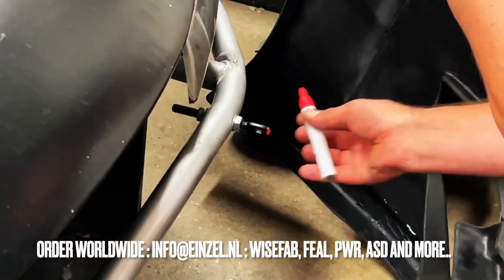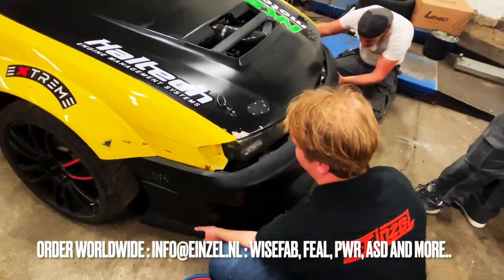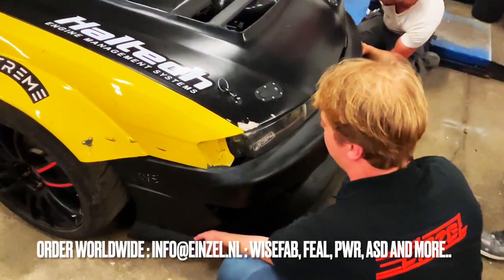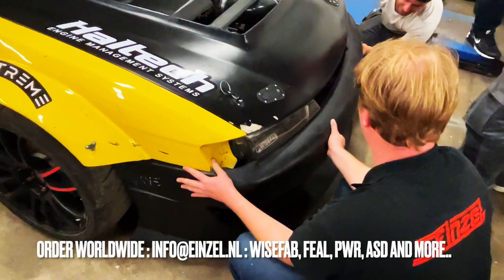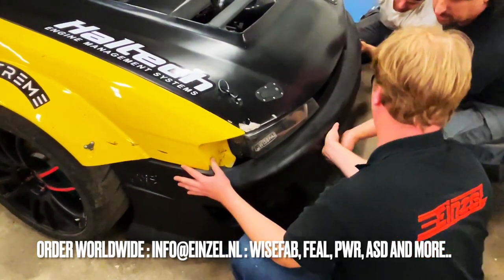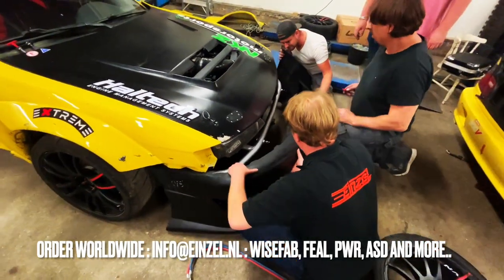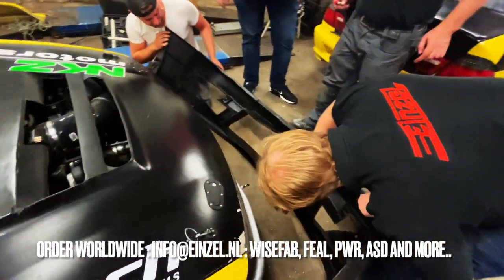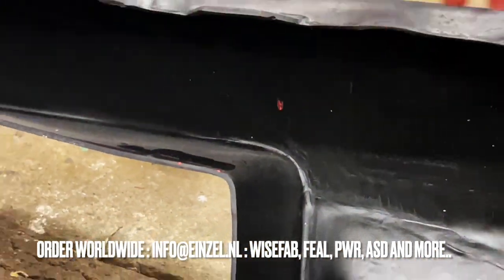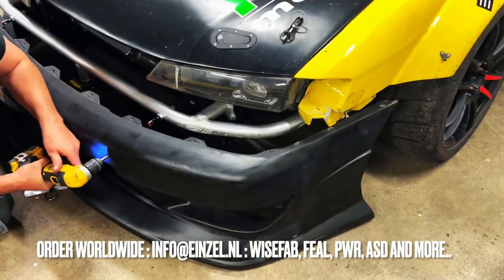Make sure there's a lot of paint on there, then hold it in the correct position in one go. What's going to happen is that paint will make a little stain on the inside of the bumper and you'll know exactly where to drill that hole. The guys are positioning the bumper exactly where we want it, and there you can see a little red dot — that's exactly where we're going to be drilling the hole for the hood pins.